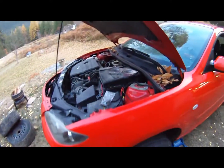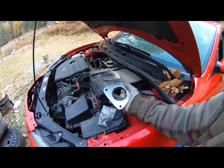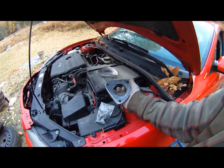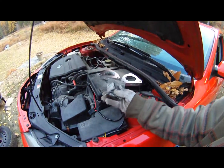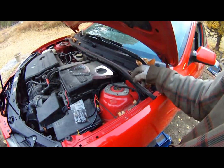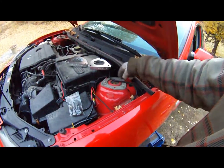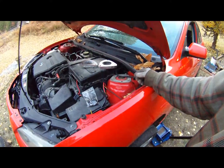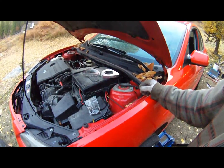Now we're ready for the front. I've made this kit myself — I plasma cut the spacers. The center holes aren't the prettiest but they fit properly and nobody's gonna see them anyway. I paint them to make them look like they're supposed to be there. I went to the local hardware store and put together a kit of longer bolts. Once this is all done, of course the car will need an alignment. The front spacers are three-quarter inch thick and the rear ones are one inch.